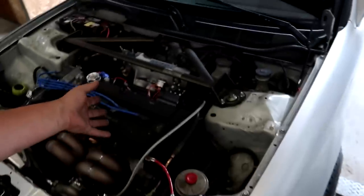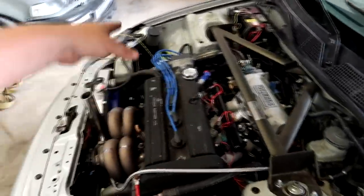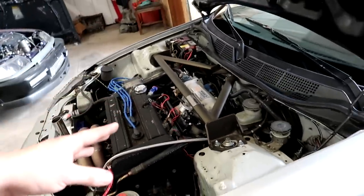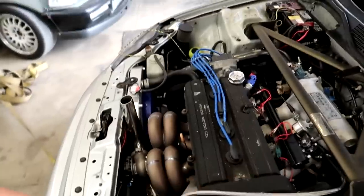So I'm gonna do that, get the air fuel around 13.5 to 15, so it'll idle a little bit more steady too, even though it's not too bad right now. These injectors, I'm telling you, they run great. No product plug or nothing here. Once we get the idle figured out, air fuel wise, then we'll set our ignition timing, and make sure that our ignition timing matches what the ECU is telling it to do. So I'm gonna go get my laptop quick from charging, and then I'll bring you guys along in the car.